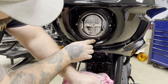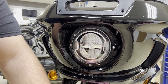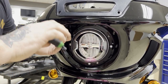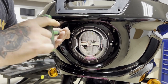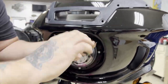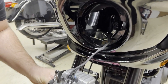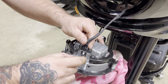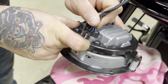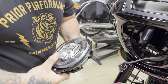Next, we're going to get in here and remove the T25 bolts — there are three of them around the headlight carriage — and pull the entire headlight assembly out. You're going to want to pry up at this tab here, not too hard so it deforms. It's in there kind of snug. Take the stock headlight assembly and set it aside — you won't need it anymore.